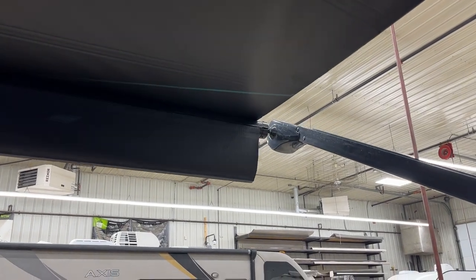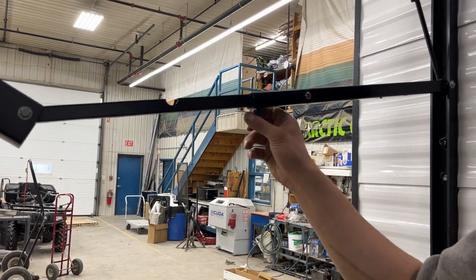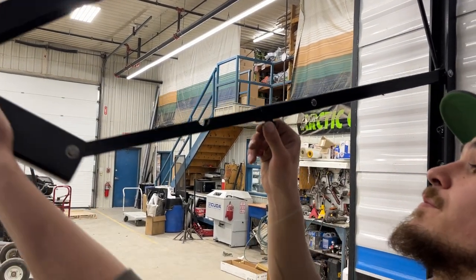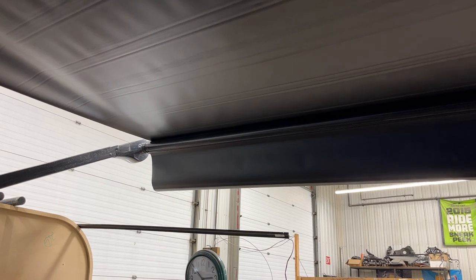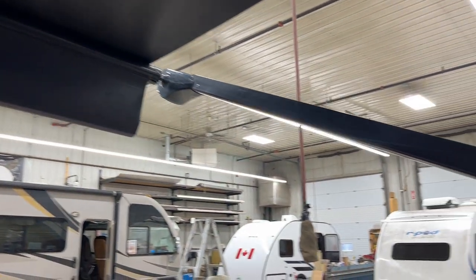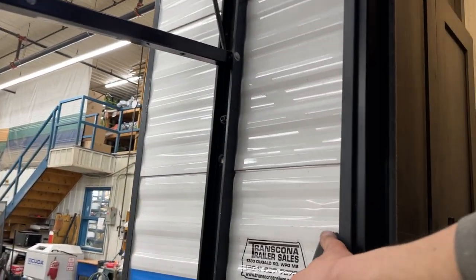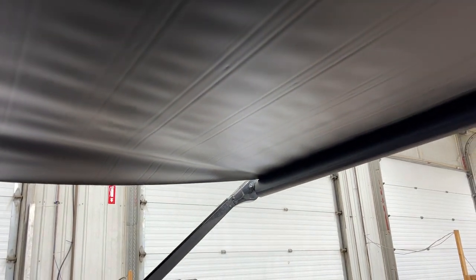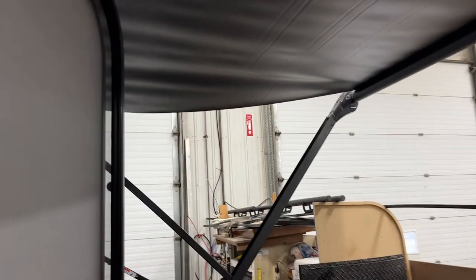There's the flap and the tube, so stop right there. If it starts raining, the awning will hold water, so on either the front or rear arm, loosen that knob, grab the arm and pull it in, then tighten it back down — that changes the pitch of the awning so water runs off the end. Before bringing it back in, make sure those knobs are loosened off and the arms are fully extended, so you're not risking bending them. Press and hold Retract to bring it back in — just watch to make sure you grab the top of the tube. Keep in mind the awning catches a lot of wind, so at around 15–20 km/h you want to bring it back in to avoid bending the arms.